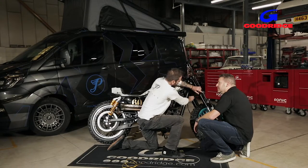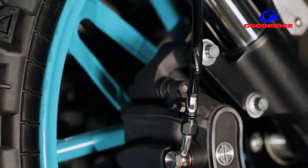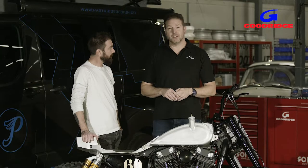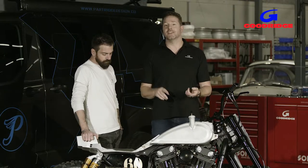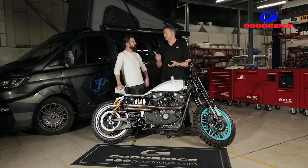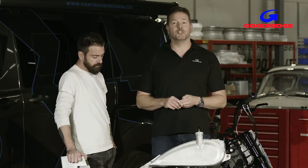And that is it. Literally that is it — then all you're going to do is bleed the brakes. It really is as easy as that. And that's the beauty of Build-A-Line: they're pressure tested to 2,000 PSI and they're fully road legal. Measure it, buy it, fit it, bleed it — and that's it. Find your nearest Goodridge dealer or pop along to goodridge.co.uk.